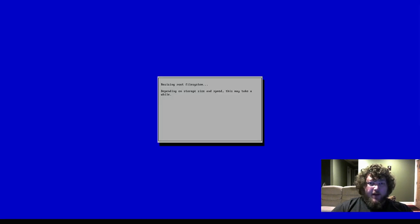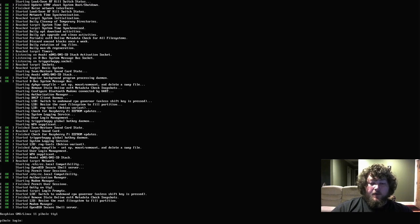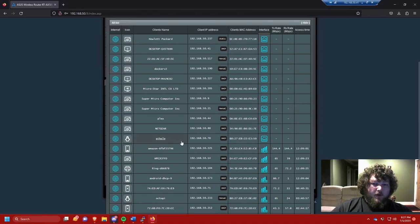Now we're doing the first boot of the Raspberry Pi. We can see it's going through the menus and doing the original setup for the first time. It should come online with a hostname and password so I can log in via SSH. We can see in this screen the actual output from the Raspberry Pi — it's at the login screen, it power-cycled, and everything is online. I have link lights from my switch to the Pi. Let's go over to my router — in the network map we can see PiHole is listed with an IP address. I'm going to SSH into that address.